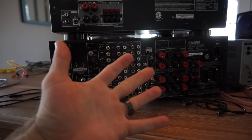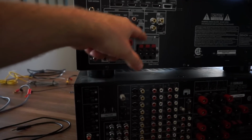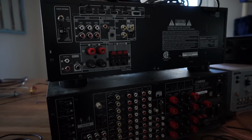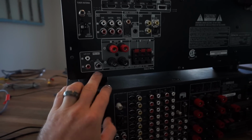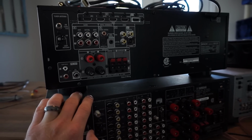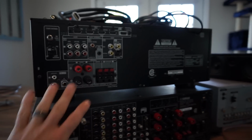5 speakers. So your left, right, center, rear surround speaker, right surround, and left surround. That's the first 5. Then you have the .2 or .1, which will be your amount of subwoofers. Then the last number, the .2, is your height speakers or ceiling speakers, which will be a different connection.